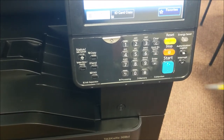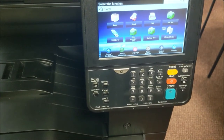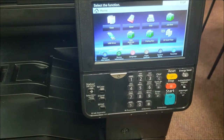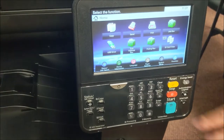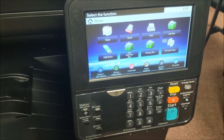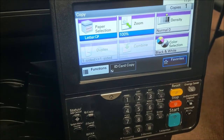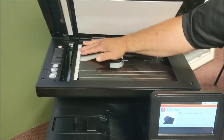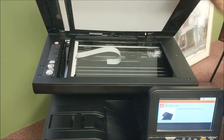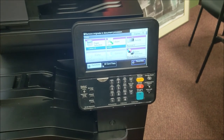Even though it says fax, you still have to have the fax option installed. Going back to the home key, if fax is there then your fax will actually work. The USB port is located right here — it will allow you to scan to it or print from it. Place your USB drive in, hit the USB button, and it'll find all the documents on there so you can print from it. For ID copy, healthcare facilities use that a lot — press ID copy, put your ID on the glass, press start, flip it over, press start again, and it puts the ID or healthcare insurance card all on one page.